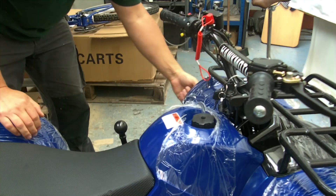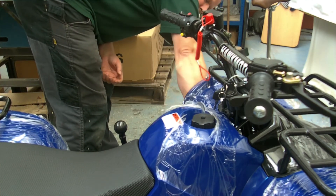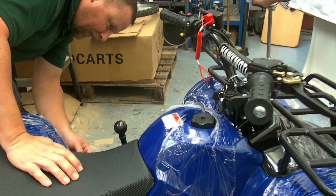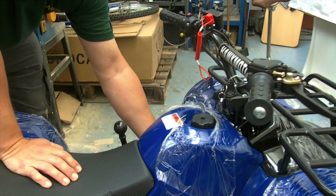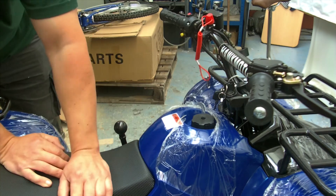There's a fuel switch under this side. It's off at the moment — let's turn that to on. On this side as well, you've got a manual choke. It looks a little confusing because it looks as if the choke should be on when you pull it up, but it's not. The choke is off when it's pulled up, and the choke is on when it's pushed down. So I'll push it fully down now.